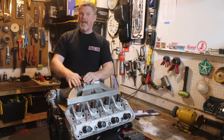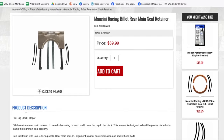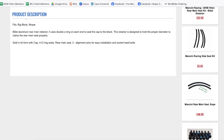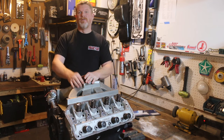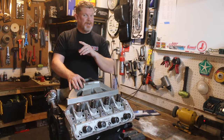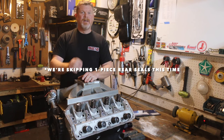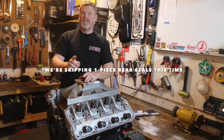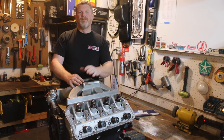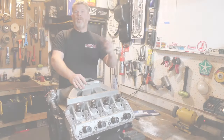Today we wanted to focus on how you can get the best rear main seal on your crankshaft with your B, RB, and Hemi engine using the Mancini Racing billet aluminum rear main seal. There are two different versions of this — we're going to show you the factory style rear main seal versus the billet aluminum Mancini Racing rear main seal, as well as the differences in gaskets, including the crush gasket around the crankshaft and the side seals.